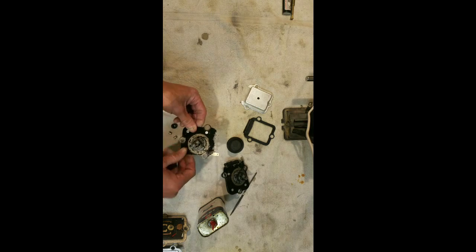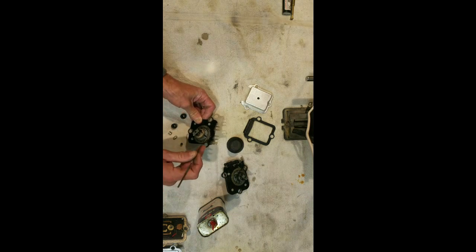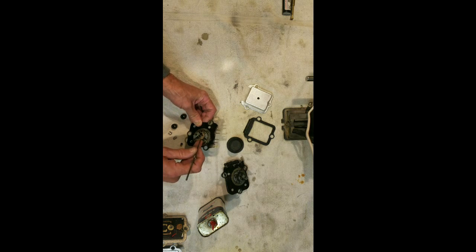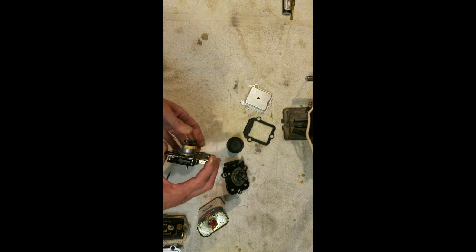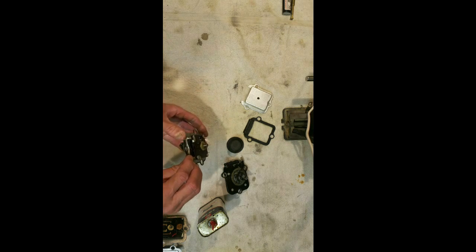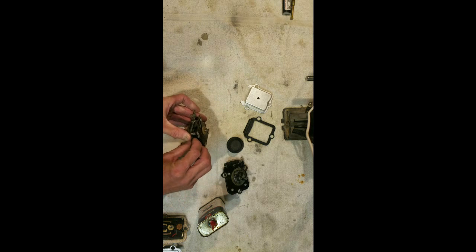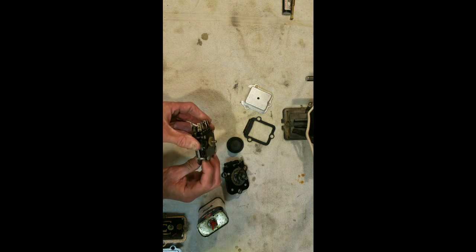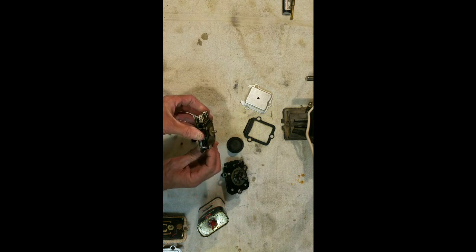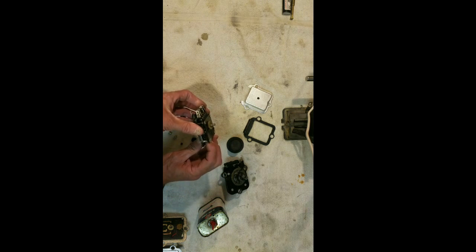After it soaks - and I'm talking a lot of times I let it set a week - first of all you've got to make sure the armature's moving. There's windings on the armature, but if you get something pointy you can move that armature - but don't push on the windings - and that'll break it loose. The one that goes to the motor winding is the back bottom one in the corner, and you can get that thing where you can turn it with your finger. If you can't, it isn't lubricated and something's bound up in it.